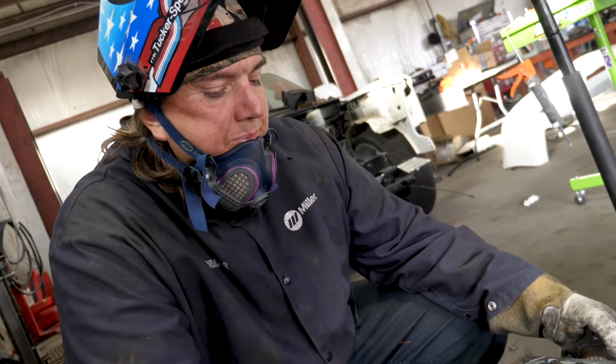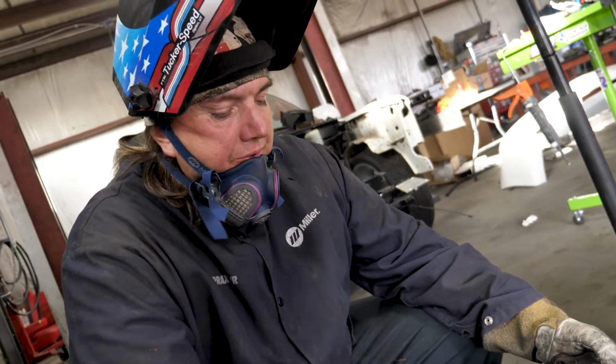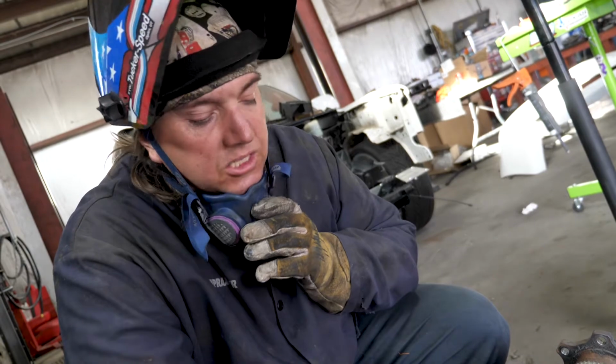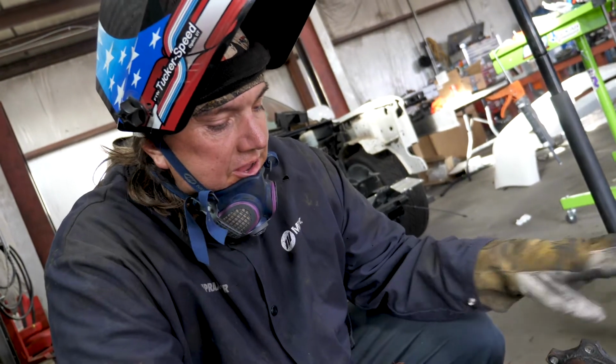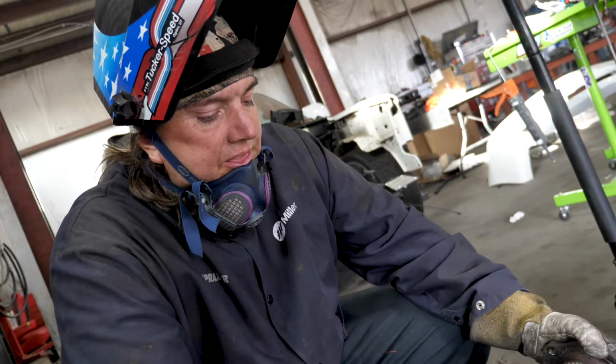Alright, I got her welded up. It is hard to get good clean welds because it's just like the dirtiest, oiliest, oil-soaked metal you've ever dealt with. So just go slow. Like I said, I use that spatter spray between each weld, so it's just everywhere. Coat your rings and just coat everything. You don't want any weld slag sticking to anything.